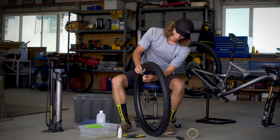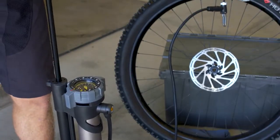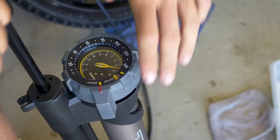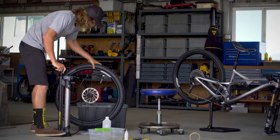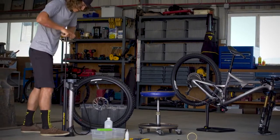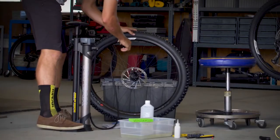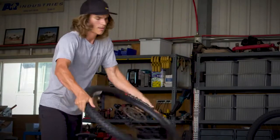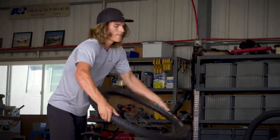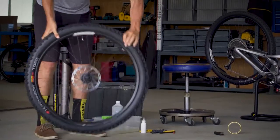We're now ready to do a final pump on our tire. And switching to charge mode, pumping up to 160 psi. We can now switch to inflate mode. Spread the sealant around within our tire. And since we're already in inflate mode, you can bring your tire up to the desired pressure. Move our pump. And evenly coat the walls of the tire with sealant. I find that for problem areas, bouncing the tire quickly resolves it.